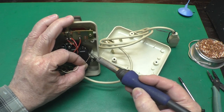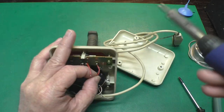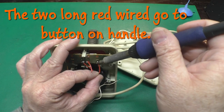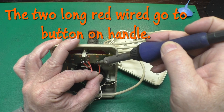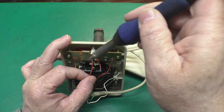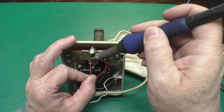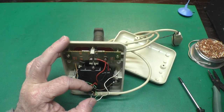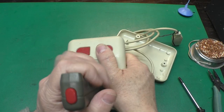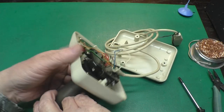You can tell which end is up because this little red wire is the only one that solders to one of these little tabs on the angled piece. So I won't mark this one since I figured all that out. As I'm going around removing wires, I'm making sure that the color code on this one matches the other one — and it does. These two wires are on big ground planes, so they take a little time to get hot enough to desolder. These are from the switch on the handle. All three switches are live at the same time, and no matter if you're right-handed or left-handed, you might accidentally bump the switch, which is kind of a pain.